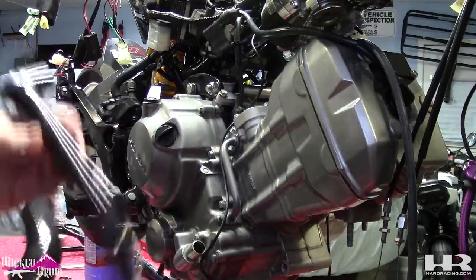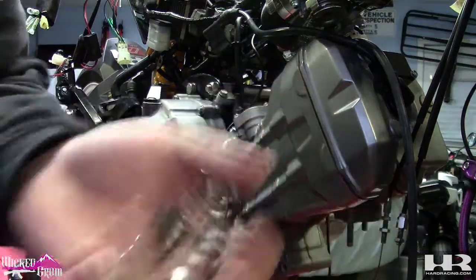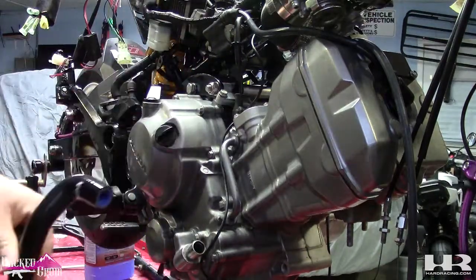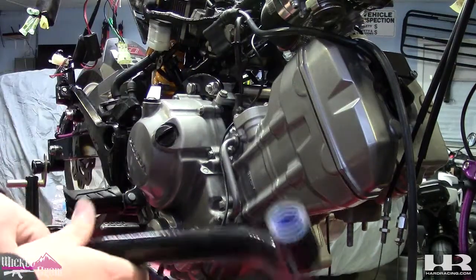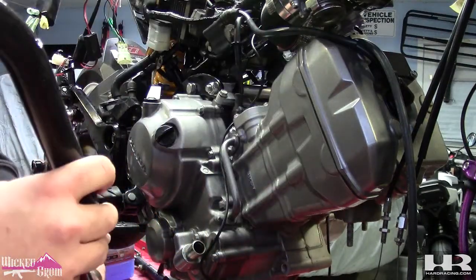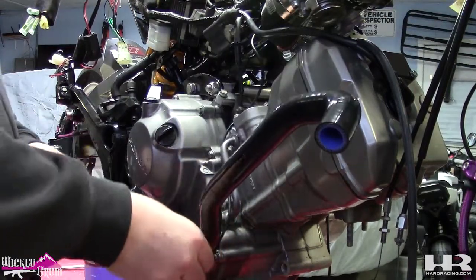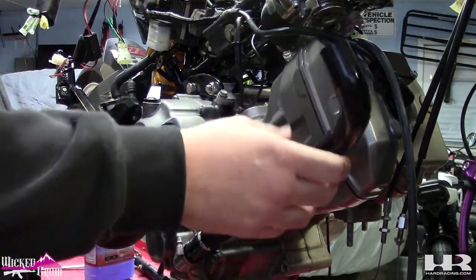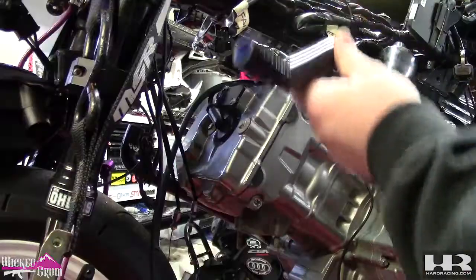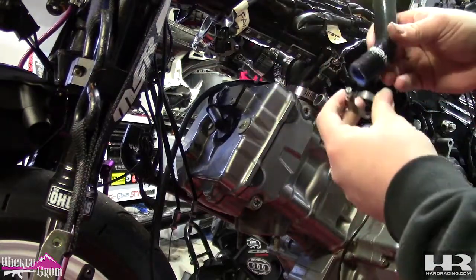Next, we're going to put the hoses on. These are the factory clamps. I'll link a set of these in the description. The long tube goes on the right side, and the 90 degree goes on the top. Short one goes on the left side. Don't forget your clamp.